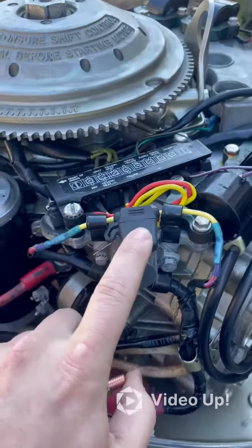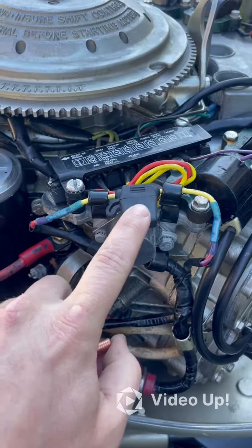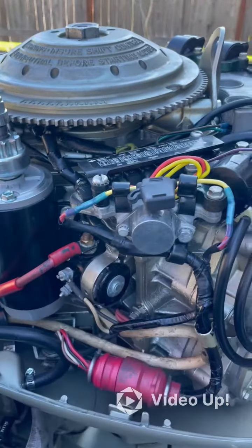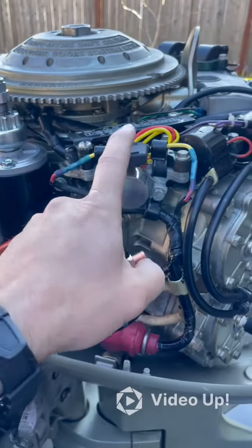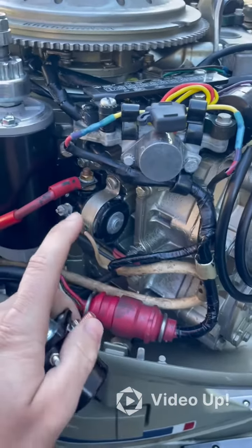Two, check this fuse — this is your main fuse. The old ones used to be a glass tube; I swapped it out for a regular fuse, but the main fuse sits right here above your rectifier. If that fuse is bad, it's because something shorted or you left your key on too long and caused the entire system to short out. Replace that fuse and see what happens.